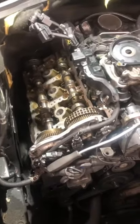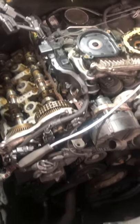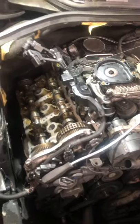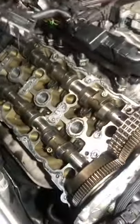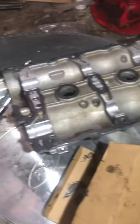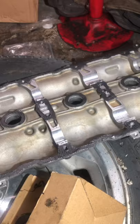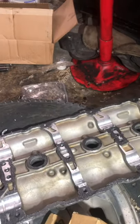We're in the process of putting the silicone. There are a couple of things I need to put back before I apply the silicone because I only have 10 to 15 minutes for it to completely dry. This is how you do a proper sealant on this type of cylinder head cover — you put light silicone, light silicone. And if you want insurance, here's your insurance: very very light. If you have an air bubble or something, your securement still holds, but you still put it all light.